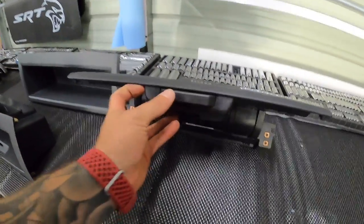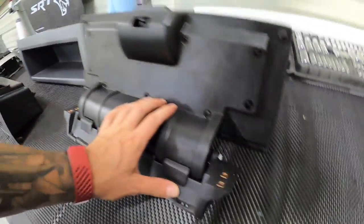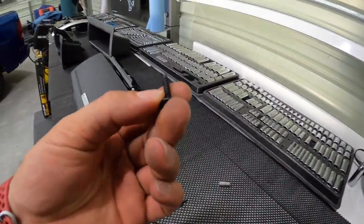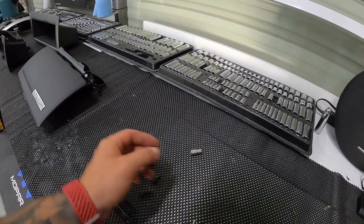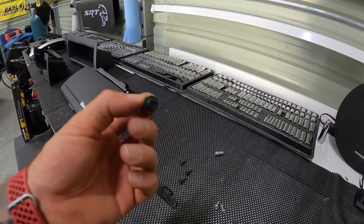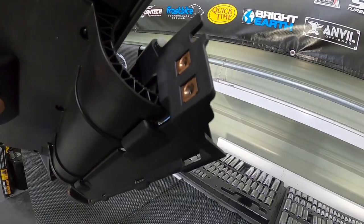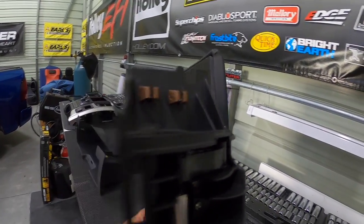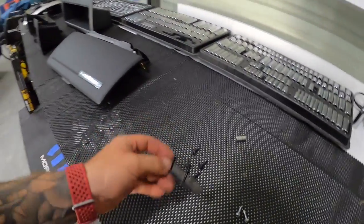There's a little peanut style bulb in there, and you'll also see the cutout for the latch so that it can engage on the actual door. The hinge is included and you'll see these four inserts. I point out the inserts specifically because the thread on this is very specific — if you try to use a self tapper or some screw that would fit, you could probably strip it. Even though it's probably gonna be overpriced, I would recommend getting the factory screws because this metal insert is just in plastic and you can spin it, strip it, and then you'll be in for a bad day.